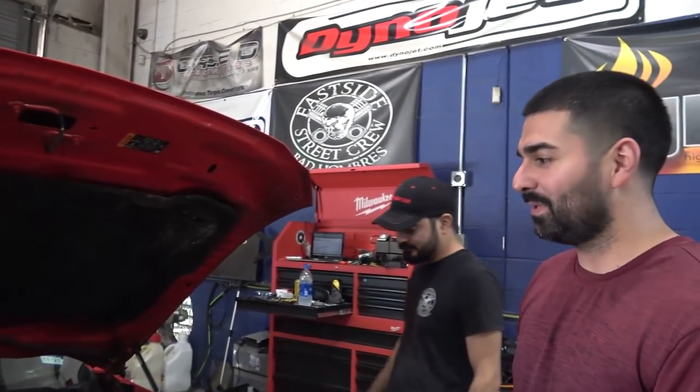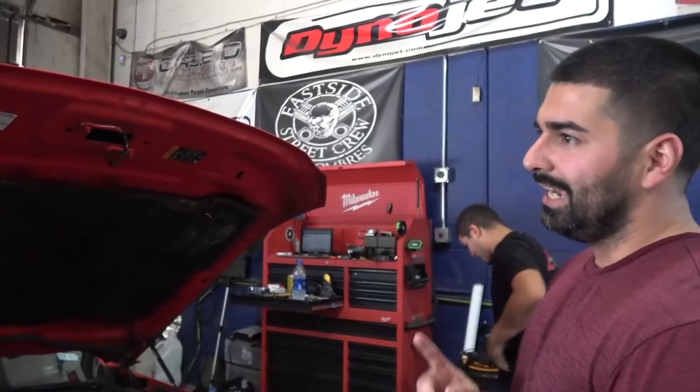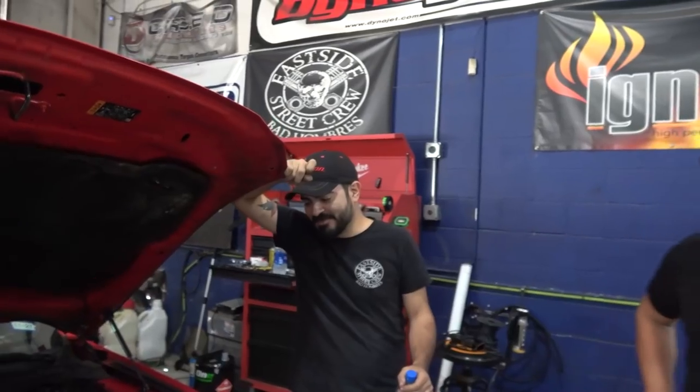So this car belongs to our good customer Trevion. He used to be a Camaro guy until he saw all the fast Mustangs coming out, and he's just like, you know what, I gotta have it. He bought one that had a Roush blower on it and it already had some work done — a fuel system that was so-so, some suspension pieces, and shitty injectors. It made some power but it wasn't quite up to his standards. He said hey, how can we make some more power? Let's do a Paxton on it and fully sort it out and see what it makes. We're making right at about 811 to the wheels with an automatic in third.